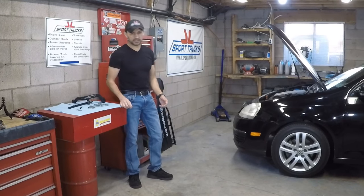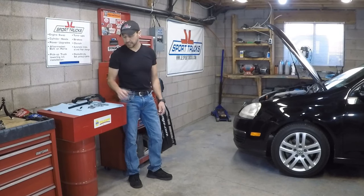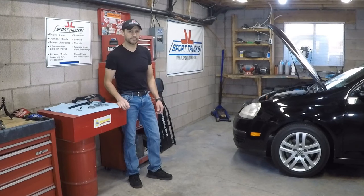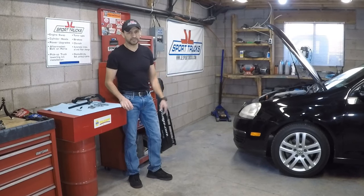If you are subscribed to our channel, you already know that the vacuum pump started leaking oil, which ran down into the starter and ruined it. When I started checking prices for replacement vacuum pumps for this 2.5 liter engine, I came across this delete kit — what a great opportunity to not only replace the part but actually improve something. By doing this, I'm getting rid of this leak forever, and it will also free up a couple horsepower — less drag on the engine.